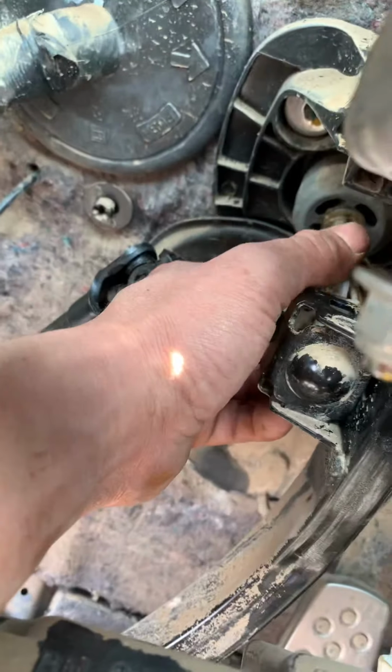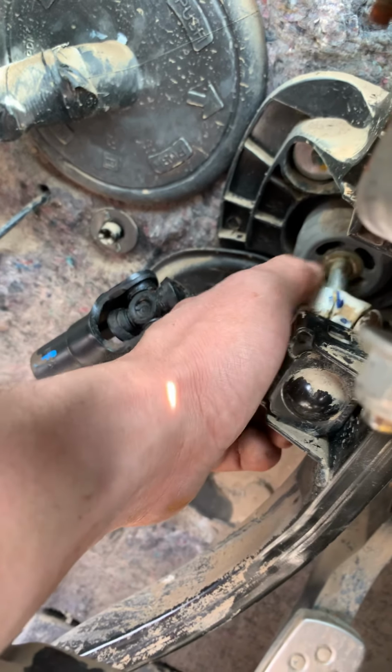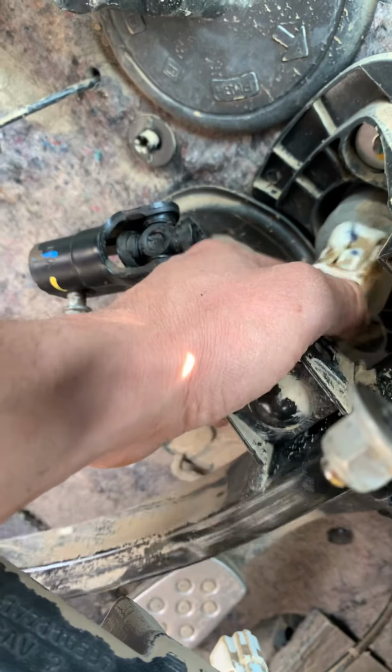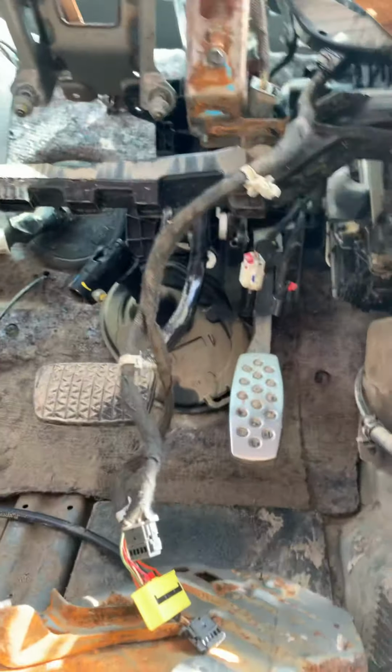Oh shit! To release the brake pedal from the brake booster bar, it's inserted like this. So you just squeeze on this top tab, and there's one on the bottom in the middle. Squeeze on it and pull back, and pull the brake pedal out, and it'll pop right out. Can you see that? Ew, greasy. Is that Vaseline from my hand I was asking earlier?